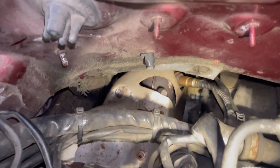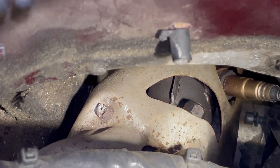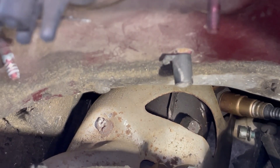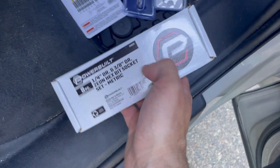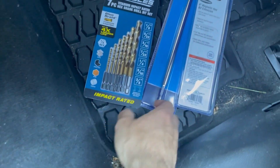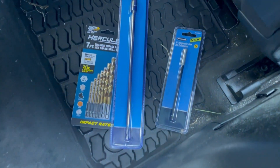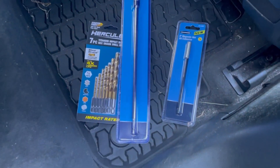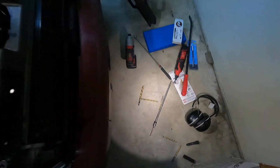All I was doing was taking the bolts off the heat shield, and one of them decided to get stuck. Everything else had come off, so I cut a line in it thinking I could put a flathead in — but it's got too much resistance. So I made a visit to Harbor Freight and got some backup: extractors from Amazon, a drill bit extension, and another extension in case it doesn't reach. All these drill bits completely smoked — and when I say smoked, I mean smoked.